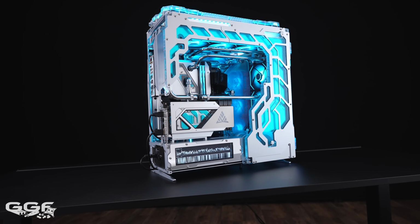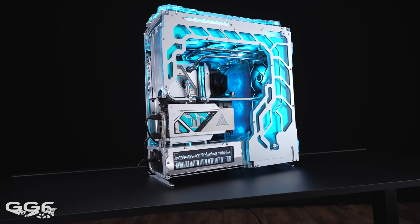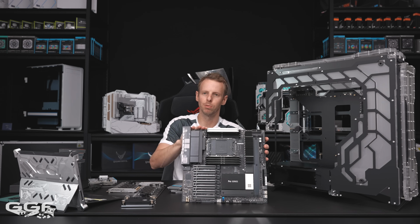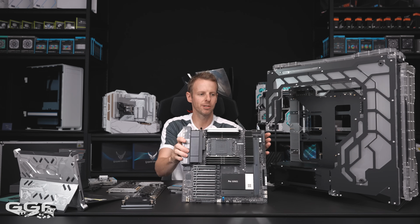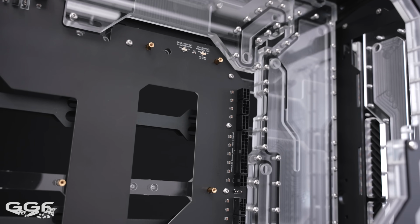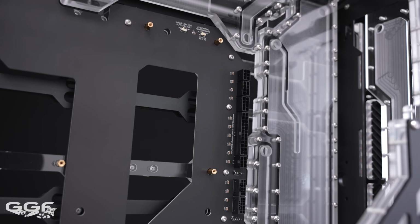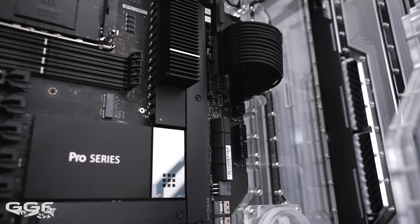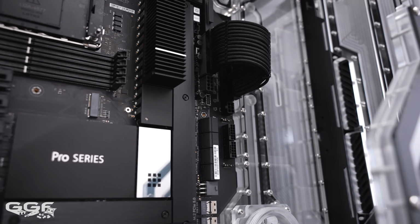It's kind of tricky. These boards can fit in some ATX cases. Obviously, they're just going to be a lot wider. They're probably going to fail on items. And if you want to fit this board in the standard Spectre, it is going to fail on the power board that runs down the side. So their power board literally allows you to run short cables along into the power board, and then that power board connects to the PSU. So they specifically designed this chassis for boards like this.